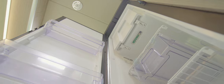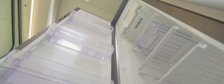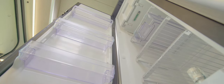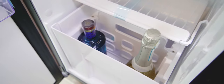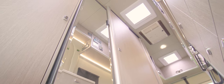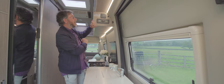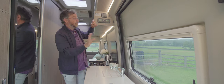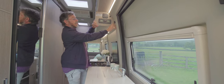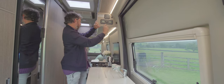The fridge is a massive 152-litre tall compressor fridge — RP don't use three-way fridges as compressor fridges are more efficient — and this is about the biggest compressor fridge I've ever seen. Running on 12 volts, it gives you a week of independence from site facilities. You can also shut off the gas safely from a switch inside rather than going outside before driving away, and a gauge shows your gas level in the under-slung tank.